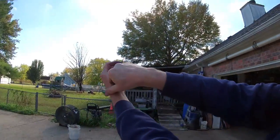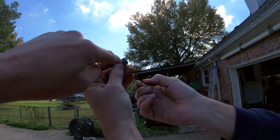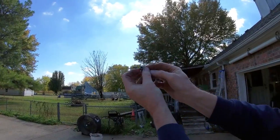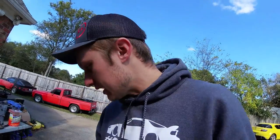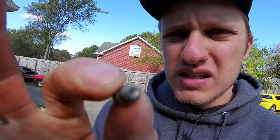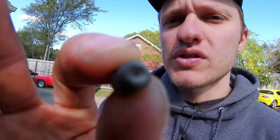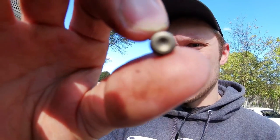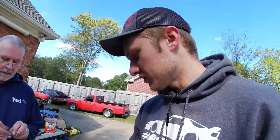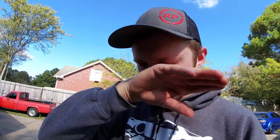If you look through there, you can't see through this one - it's blocked, it's clogged. But this one you can see through. One thing that is huge with carburetor work is that most of your jets - a jet is basically a hole, right? You should be able to see light through there in some facet. That's a good visual inspection for your jets after you've cleaned them.